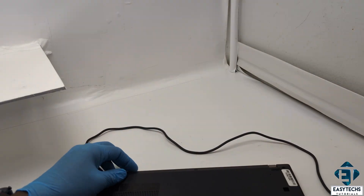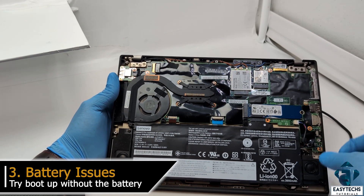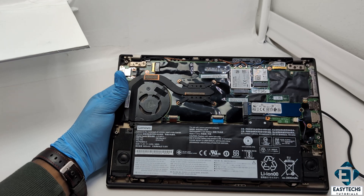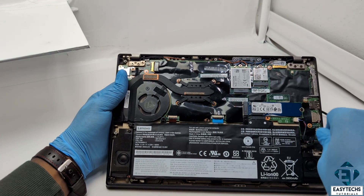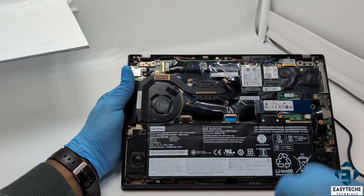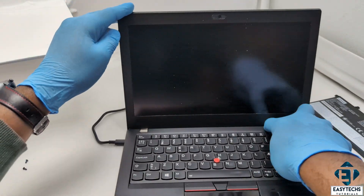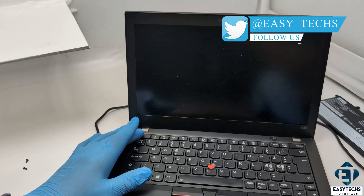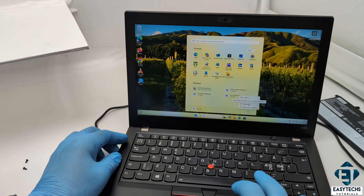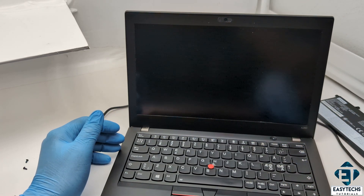I had to unscrew the back cover to check deeper. The next thing to check in situations like this would be the battery. A defective battery could prevent your laptop from powering up even when you have it plugged into a charger. It's important to mention that a battery being low or empty doesn't mean it is defective — by defective, I mean the internal circuitry of the battery is defective, triggering the overcurrent protection mechanism on the laptop. So here I will simply remove the battery, perform a power reset once again, and then try to power up the laptop on the adapter only. That didn't resolve the issue either.